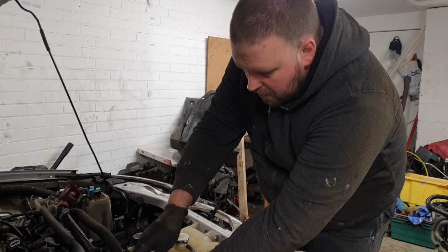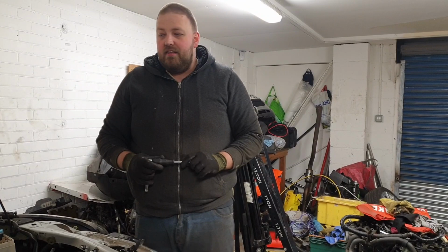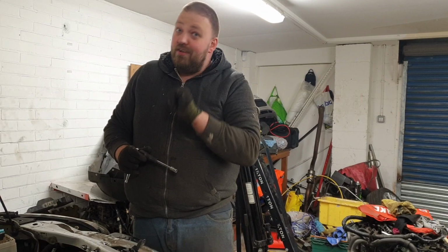Disconnecting spark plugs and coil packs, but don't worry, YouTube hasn't broke. You're not back at the start. You are at the start. We're almost ready. We're going to stick the battery in, we're going to crank it to get oil flowing around the engine basically, and then we're going to reconnect all of them, crank it again, and hopefully something will happen.